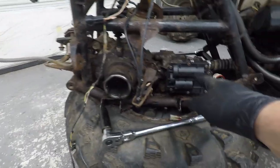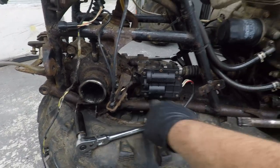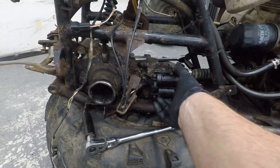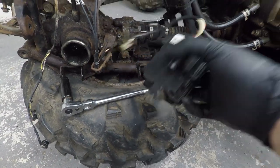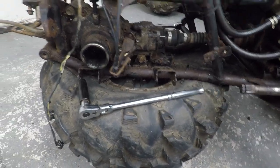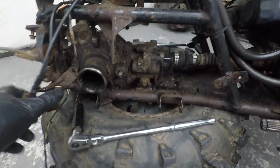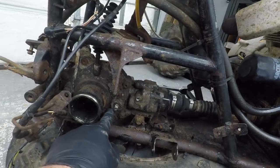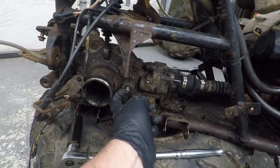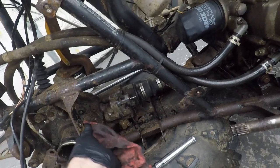First thing you gotta do is take off this box. I've already kind of loosened some of this stuff up. There's a screw here, there's a screw down here, and then behind it, I'll go ahead and slide it off because I've already pulled it off. Behind it, there's a screw right here too, next to this plunger. So go ahead and get that off. This here comes off. It's got two screws, top and bottom, as you can see. It's got a little cable slide that goes in here. You just move it sideways and push it down because it's slotted on this side right here, so the cable just pushes out. And then you just got like a little connector right here, a little bullet connector.